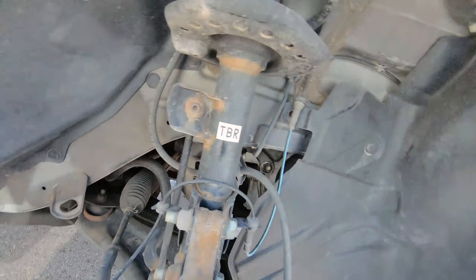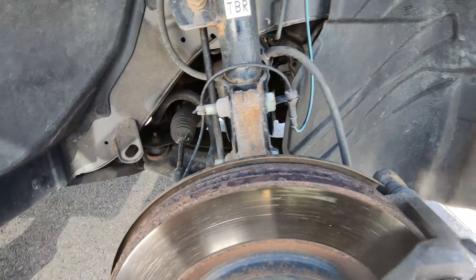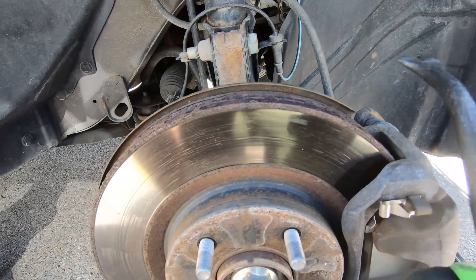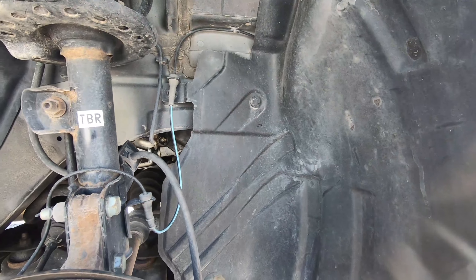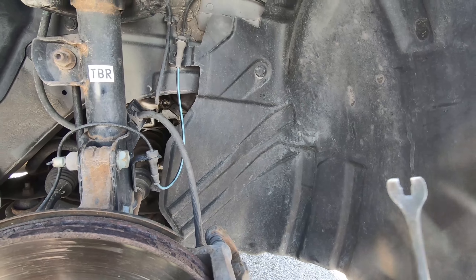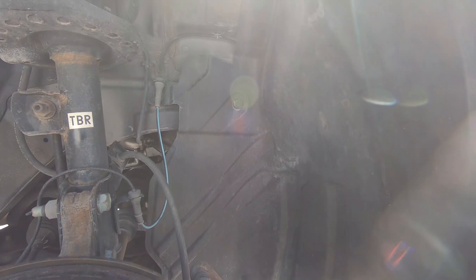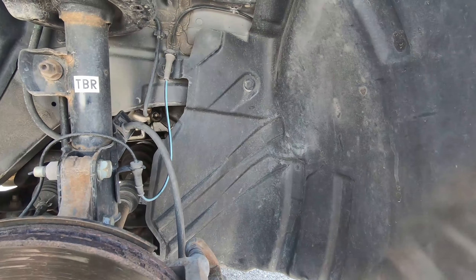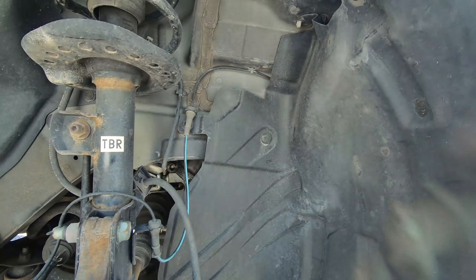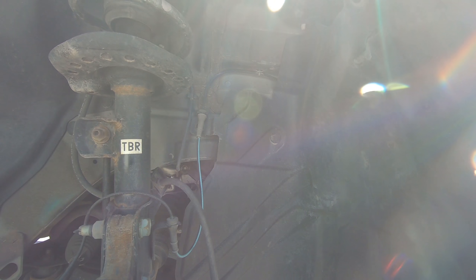Okay, here we are. We're just about ready to get down to that belt. We had originally almost planned on doing brakes on this vehicle as well, but per the customer's request we didn't do them. I'm going to recommend that he does these based on the amount of rust and wear on these rotors. Also, when we were changing the spark plugs on this vehicle the other day, there was oil in one of those spark plug wells, so he's going to need a valve cover gasket done as well. Depending on how they make these valve covers, I'm not sure if those valve cover tube seals are serviceable or not - some vehicles aren't, like some Nissans. The whole valve cover itself may have to be replaced.